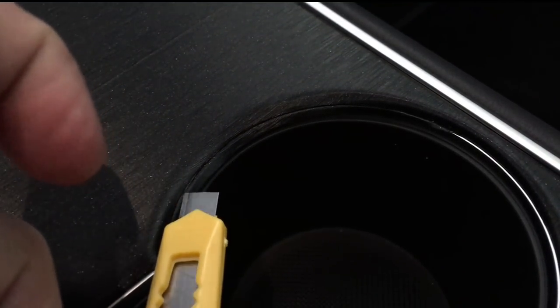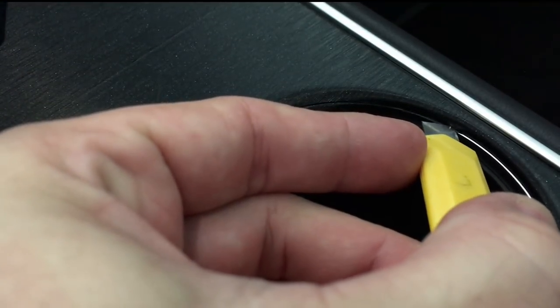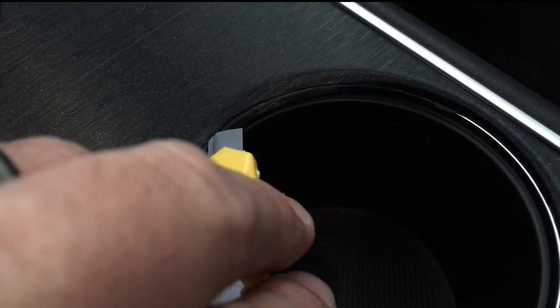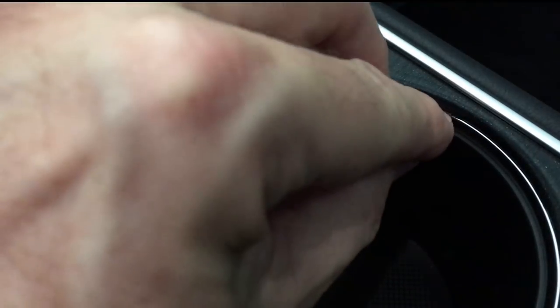Here's some things I learned doing this for the first time. I found out with the car's AC on, the vinyl became rigid. That's why, if you notice in the video, I had to use the blow dryer a lot to help it become more malleable. If creases develop, pull out that section a little bit and heat with the blow dryer, and the wrinkles disappear. If you do get a bubble, heat it, and pressing down usually gets rid of it. And if you get creases, you need to pull back a little bit and try again.